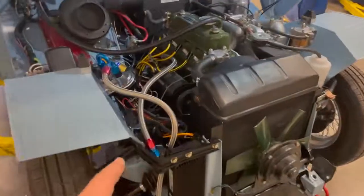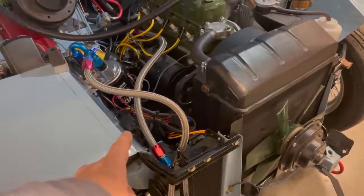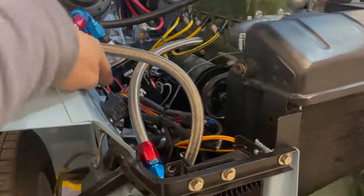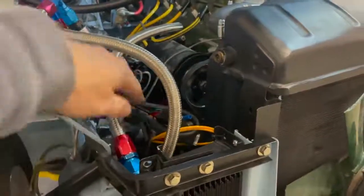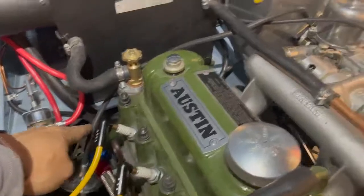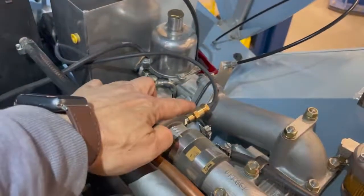I have the radiator fan all wired up now. I found out that I did need a relay and a bunch more wiring that was not designed into the wire harness. Apparently when they built the wire harness they designed it to plug into a relay and none of the rest of the wires were there, so I had to add this jumble real quick — doesn't look the best, I can clean it up later after the show. I have a hose for the advance on the distributor now, runs over to the carburetor. I also have a hose for the boost gauge, comes out of the supercharger here.